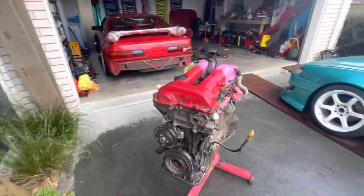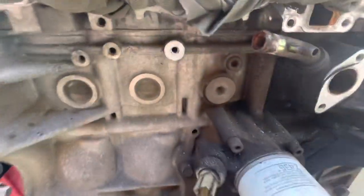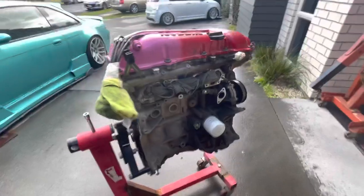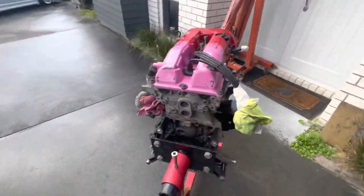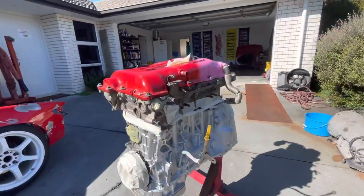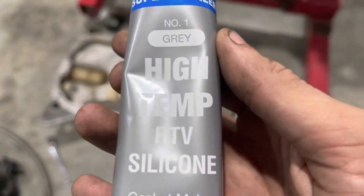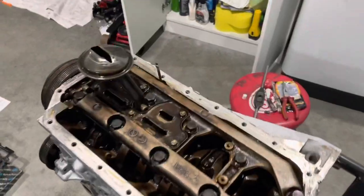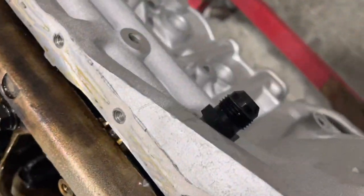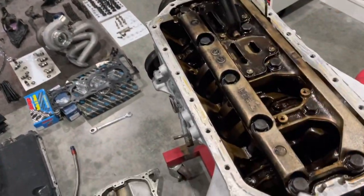That's a bare block - can't wait to clean this damn thing. Just about to put the sump on - the oil pan. Oil drain is tapped. I'm just going to lay a decent bead around here, slip that back on, bolt it down, torque it to spec. Drilled and tapped the block this morning just for the oil drain.